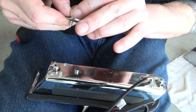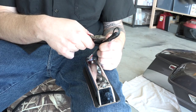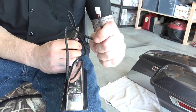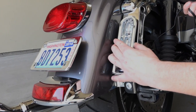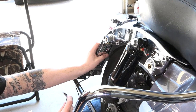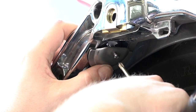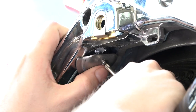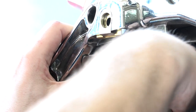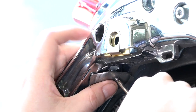He's doing this to both taillight housings, top and bottom, finishing the left side housing threading. Now the wires come bundled up — just snip the zip tie since we'll need to route the wires. Left or right, it doesn't matter, they're both the same — feed the wire through the hole and screw them in to secure. On the back side, use a Phillips screwdriver with those metal plates — the half-circle faces down. Don't over-tighten; just get them snug and maybe another quarter turn — you're going into plastic.